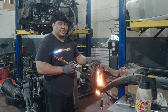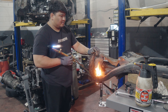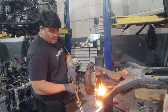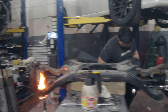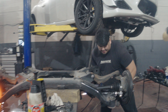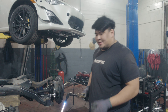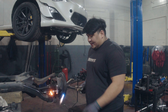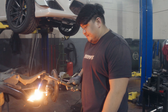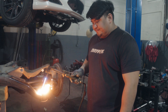How many of these jobs have you done before on this chassis? Probably my sixth one in the last six or seven years. That's a decent number. All track cars? All track cars. Was it mainly for the geometry correction or just for more stiffness? Not a lot of people think about the correction — it's mainly that they don't want the drivetrain flex. Like this bushing here, when you're pulling G's it does move around, it deflects. Though sometimes having a little bit of deflection actually gives you a bit more grip.